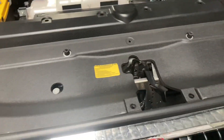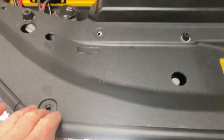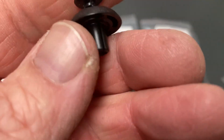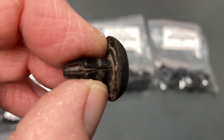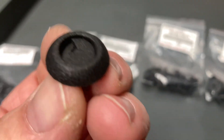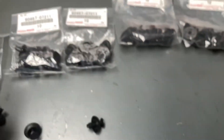Here, same thing — if they're all not there, it's not actually untidy, because who's actually sitting around with their bonnet open all the time going 'oh look how untidy it is.' So I'm recommending: if your clips get broken, don't bother replacing them. We're going to show you how these clips work. See these clips? When they're locked, you just push them down until they're flush — that locks in the bottom of the clip. When you want to release it, you push it past flush. This one's broken because they get dirt and dust in them when they get old. The plastic deteriorates. Actually good clips work well — keep them clean. But to release it, you just push it down, pop, and they come loose. That's why people lose them — they just keep pressing these things and they get lost.